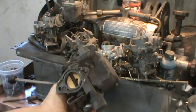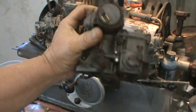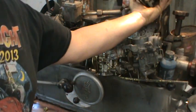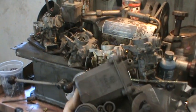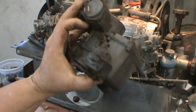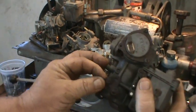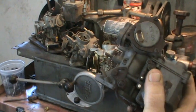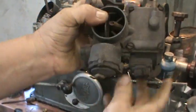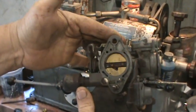Here's the big carburetor that originally comes on — I want to say a '72 and on super beetle, standard beetle. It'll be the 34 PICT. Let me look at the number just to verify that — the 34 PICT Solex. This is a pretty good carburetor. A lot of people complain about a super beetle bog on these but they're very adjustable. They have an adjustable accelerator pump on this side. Our single port won't accept this carburetor — we have a much smaller diameter. We take the 30 PICT on the early model Volkswagens.